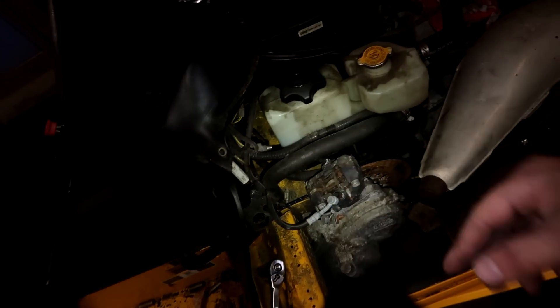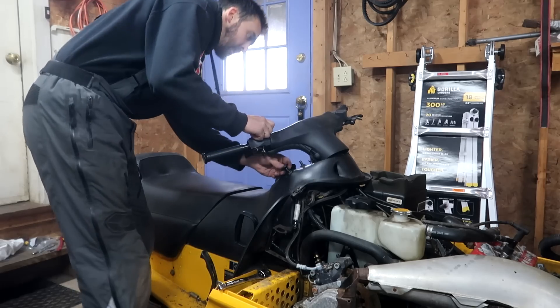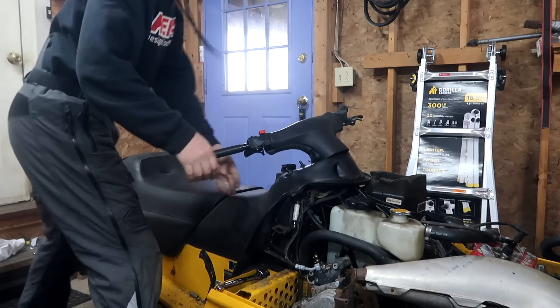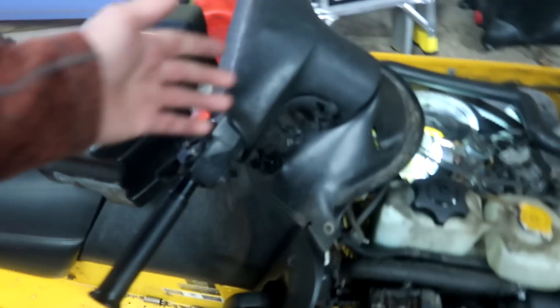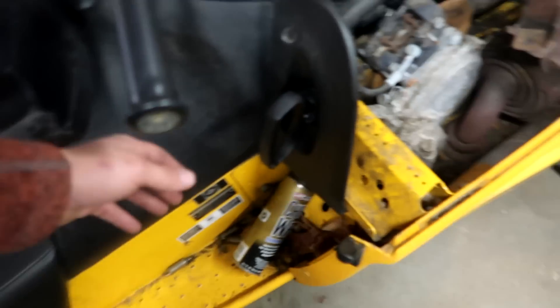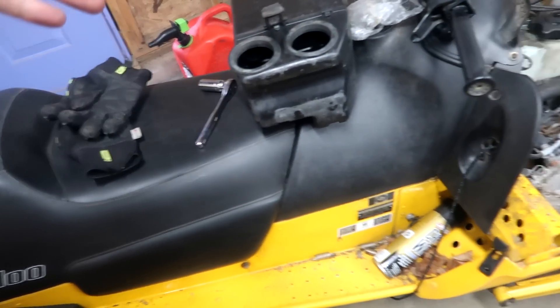I just need to put in more power — a couple more power shots down the cylinders and get the fuel running back through the lines. The primer is about here and pumps it into the system. Was it enough? No it was not. I've been sweating pulling and pulling — I finally got the primer to work. Someone on the forums said to just keep priming — one guy did it for 15 to 20 minutes. I only did it for about four minutes and it eventually started to work. But that's not our biggest issue now — our biggest issue is the recoil again. It will retract but you can't pull it, it doesn't grip at all. Stick around for part two — we're trying to get this thing running.